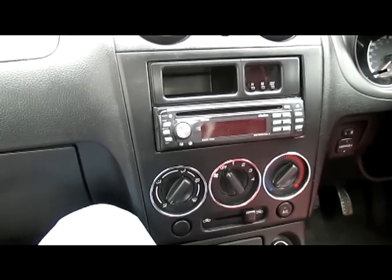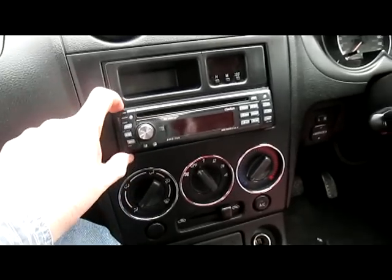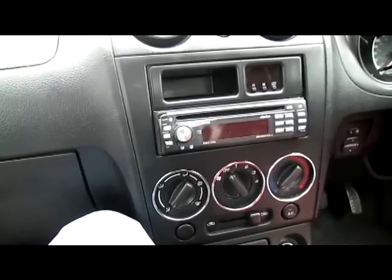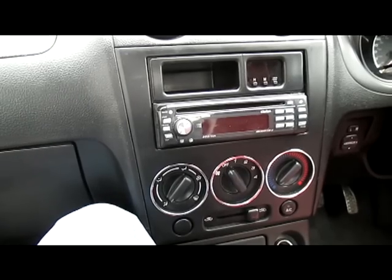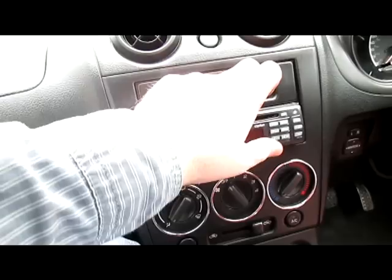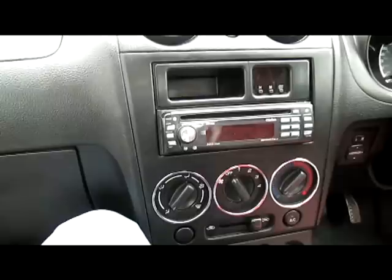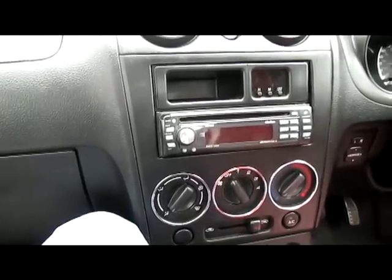Now, one thing that you might see in different car stereos is a DIN. So you'll have single DIN, which means one of these little units, or double DIN, which would be 2 of the units. I think what I'm going to do next, in the next video, is probably install a double DIN unit. Maybe I will, for the next how to install a car stereo video, install a double DIN unit, and I can pull power off of the clock here, which is tied into the accessory position in the key. So there's an awful lot of room that you can do there. It will involve having to splice cables depending on what I want to do with it exactly.